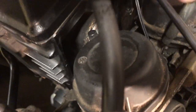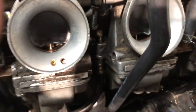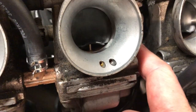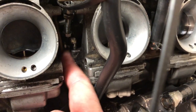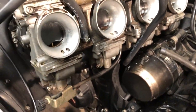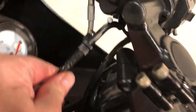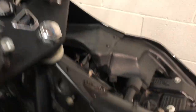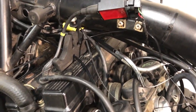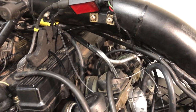I'm replacing the throttle cable as well. The adjuster out — it's quite a strong spring on the cam. It's getting to be a bit of a pain to try and get the old one off the bottom. I've got my new throttle cable routed to mimic the other one all the way up. I've left the old one in place and routed the new one while the old one's in place, so I match exactly where it goes and don't get it kinked or misrouted.